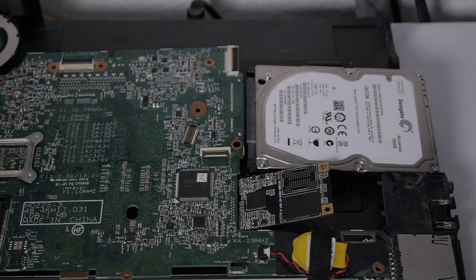For storage I'm using a Seagate 750 gigabyte hard drive — an old drive my in-laws donated to me. It works pretty well despite 256 SMART errors, but I don't mind since I'm not keeping any critical data on this machine. Most of the space is occupied by legally downloaded movies and TV shows which I can re-download even if there's a hard drive failure. ZFS is pretty good at recovering files lost due to hardware issues, but please don't rely on ZFS only as a justification to skip backups.